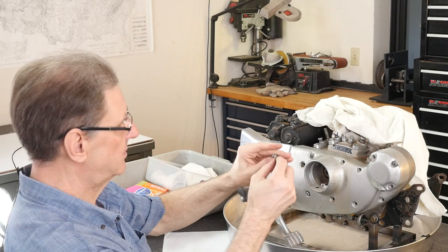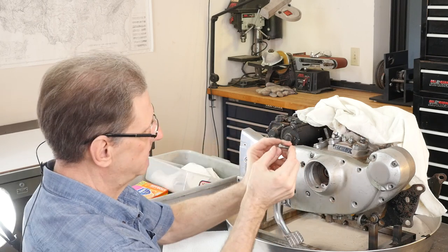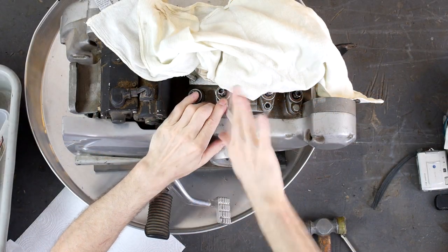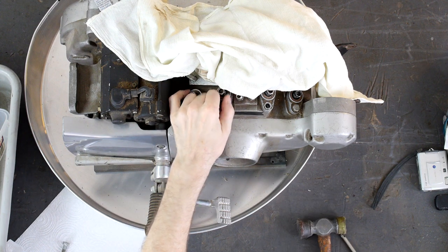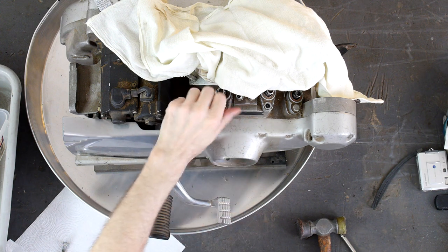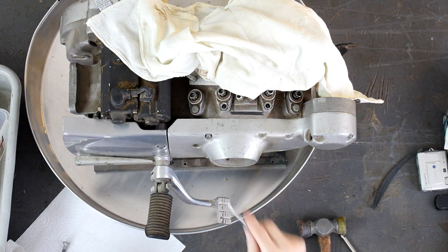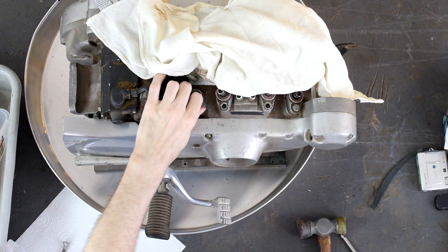I checked, there's no lock washer. I'd put a lock washer and flat washer under these, maybe get a slightly longer bolt. The factory says no, which is surprising. Usually with something this short, a longer bolt will stretch a little and that serves like a lock washer. It keeps a constant tension, so they don't back out as often. But with these short bolts, don't use Loctite. Don't glue your bike together. I hate people doing that.